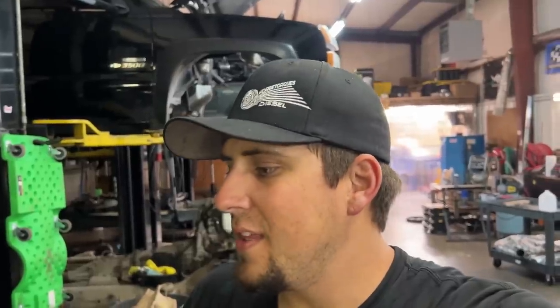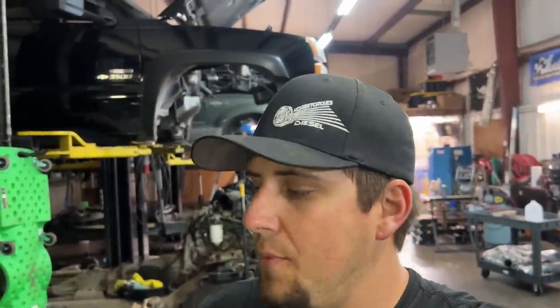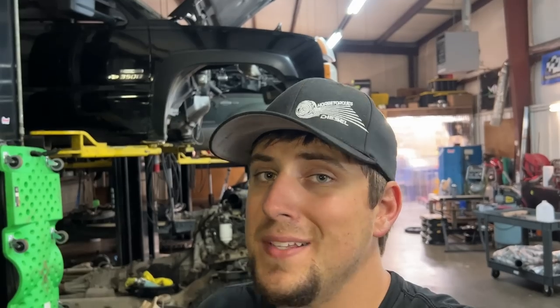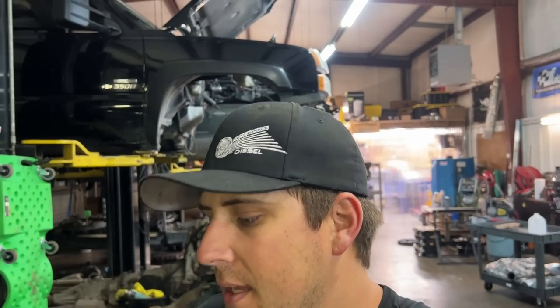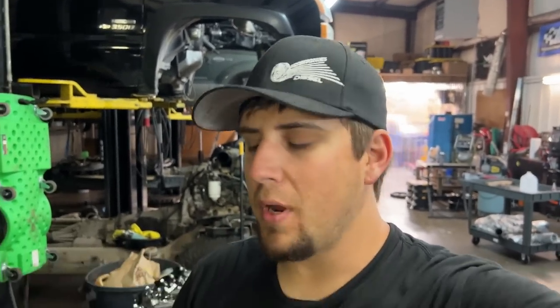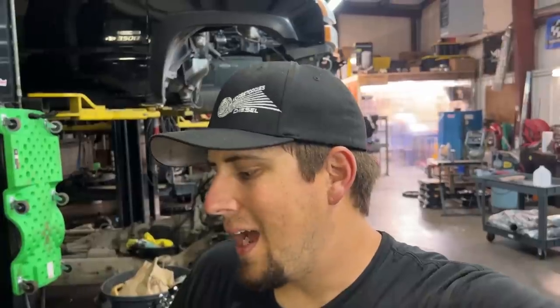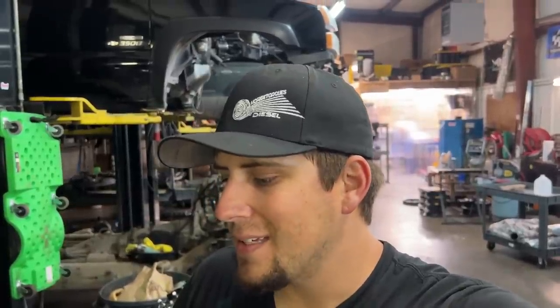But Ethan was here, and we had the truck up on jack stands to check the PCS, and all of a sudden coolant started shooting out, and I was like, dang. So we hooked up, you can't really feel a steel braided line for if it's firm or not, so we hooked up a coolant pressure gauge, fired it up, instantly started making coolant pressure. So I knew we had some kind of a head gasket issue.